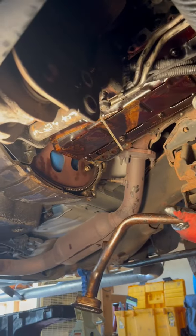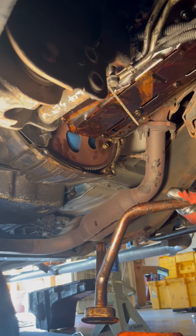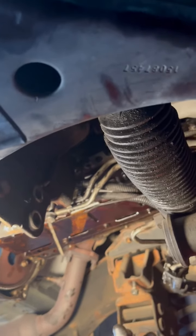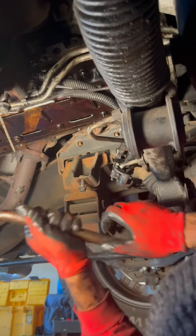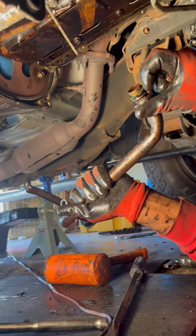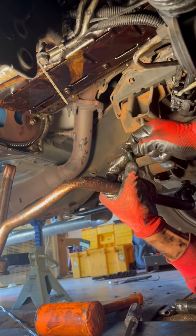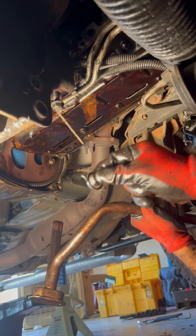So we finally got the oil pan off and out. We had to take the cross member off, and also the rack and pinion — the two bolts for the rack and pinion I had to take out and push them back a little bit so it could drop, otherwise it's not going to clear at all. Look at this O-ring — it is toast. What he was experiencing: he could drive for a little bit, but once the truck got to operating temperature the oil pressure was dropping to zero. You do not want to drive any engine with no oil pressure — that is not good.